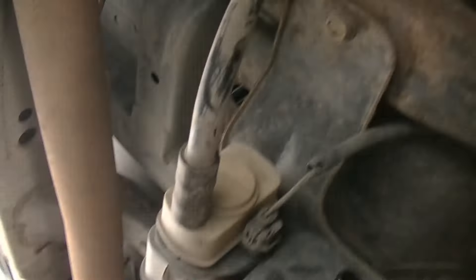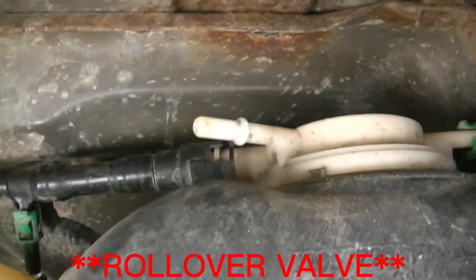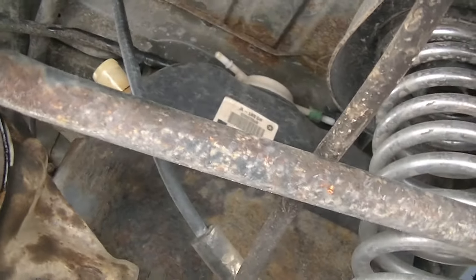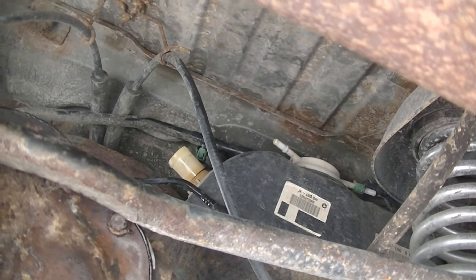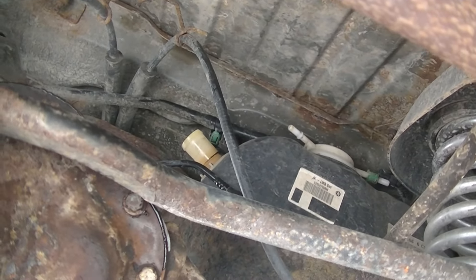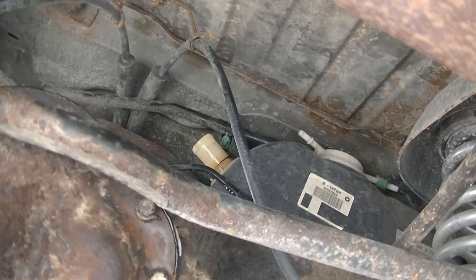We're here under the back side of the Jeep. We went ahead and disconnected the vent line from the charcoal canister, it tees off right here, we disconnected that, took our fuel filler neck off, and took off the hoses that go to the fuel pump. From what I can tell, hose-wise we're completely disconnected. I'm going to look up there and see if I can find the fuel pump connector. If I can unplug it before we drop the tank I will, if not we're just going to drop the tank nice and slow and get it once it's down a little bit.